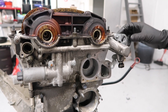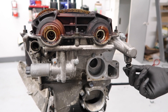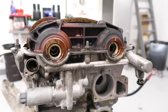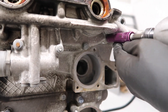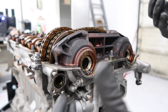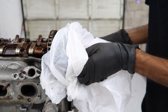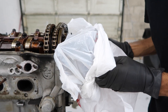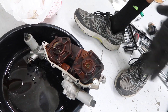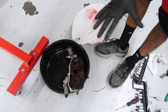Now we're going to remove the actual vanos unit itself. Make sure you have the engine hook connection removed, and also have this oil line disconnected. We'll start by taking off this 13mm stud, then remove the rest of the 10mm nuts. We're going to bag this so that when we pull it out all the oil doesn't leak everywhere. And that is how you remove the vanos. I'll make a separate video on how to take off all the seals and replace them.